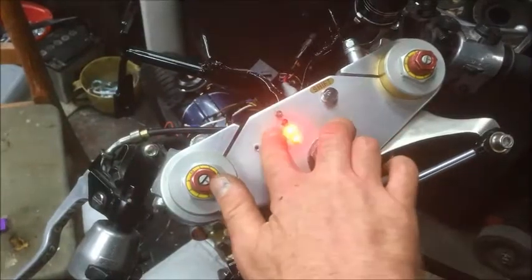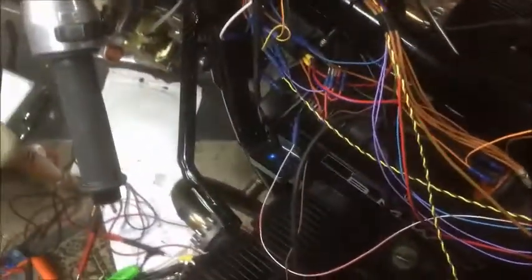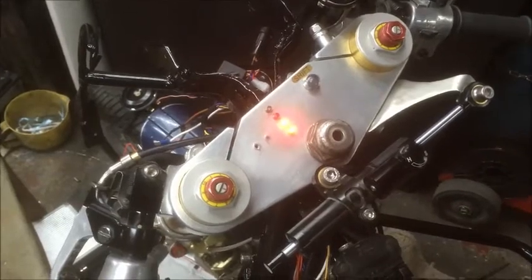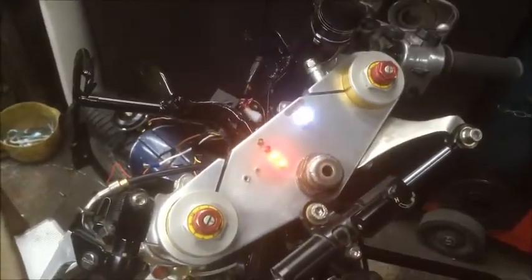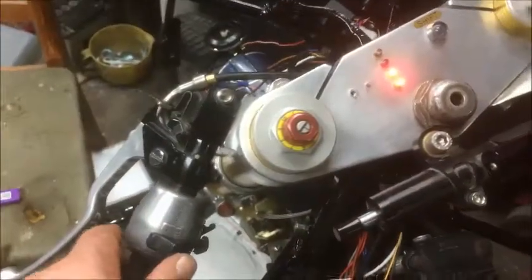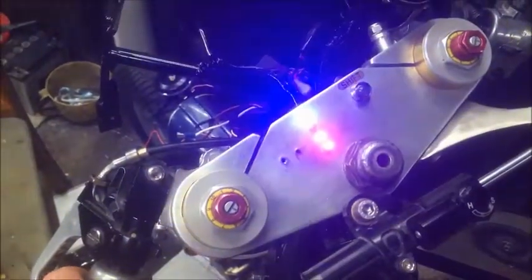The LED is all connected up. Switch gear on this side is all tidy, switch gear on that side is all tidy. All the relays - it looks messy at the minute, there's about four relays in there, I'll tidy those up a bit later. So our LEDs: when we switch the bike on - ever so bright. I've got two lights - one is a neutral light, a red neutral light. The other one is the indicator, which is here. That's my indicator - going to go to the back end. My shift light has got to go to the back end as well. The last one is my high beam - and flash works as well. They're all working great, which is fantastic.